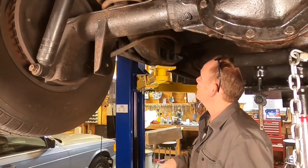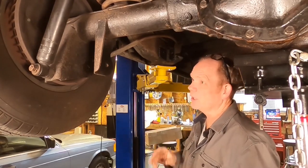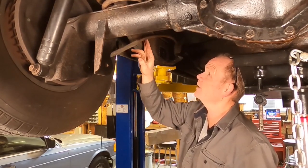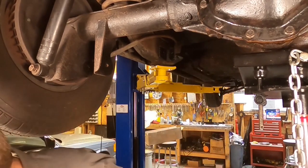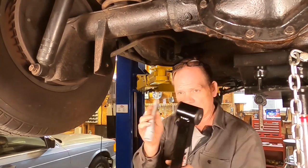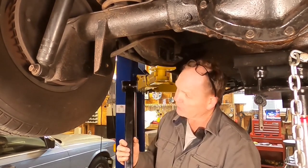The recommended lubricant from PMT Fabrication is the Super Lube synthetic PTFE stuff. I've got a small tube here and we'll put some of that on the end of the bushings, and then in my grease gun I've got a much bigger tube of the same stuff, and we'll fill up the bushings on the grease fittings after we get this thing installed. You may recall this Super Lube was what we used in the Mercedes W126 sliding roof repair job to lubricate the cable and the cable tube. And I've got brand new bolts too.